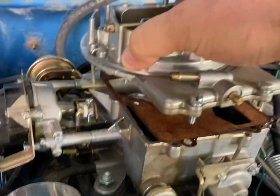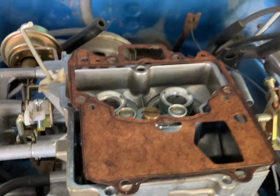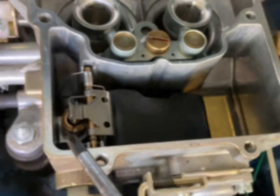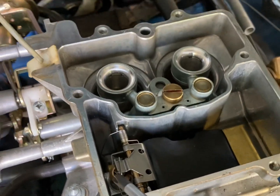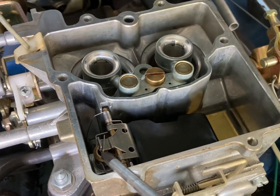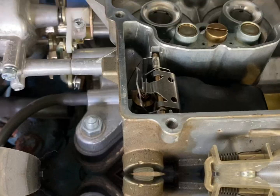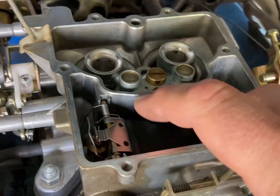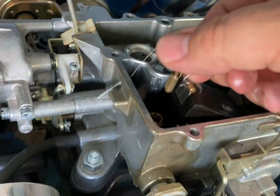Alright, there it comes and she's off — fairly easy. Let's get a more in-depth view. So we're looking down into the carb here, and this little spring that goes around that little valve right here — you need to take a screwdriver, stick it down in there and pry it off. Then the float will actually come free here on this little brass pin. When you pry it off that bar it'll look like this, and you simply pull out the float just like that. And it's out.